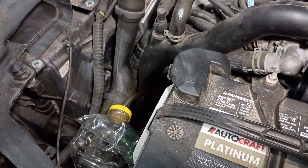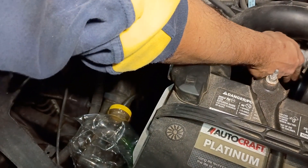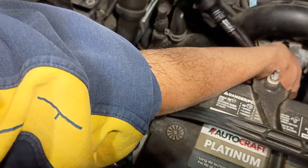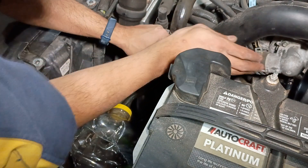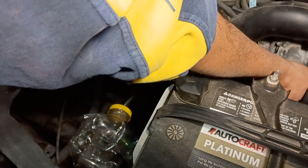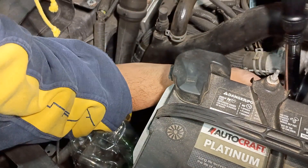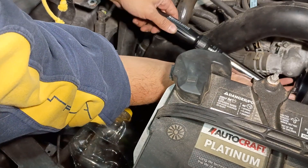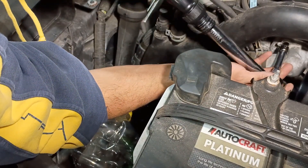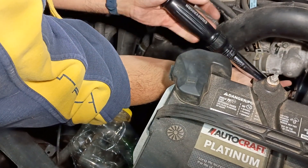There was still a little bit more mess. I was trying to capture as much of the fluid as I could so I could measure what came out and put a similar amount back in. You have to push against the housing as you're hand-starting the threads. I already got these bolts hand-started and then I'm just going to tighten them a little bit until they start to feel snug, going back and forth. These go to eight foot-pounds, or on this torque wrench that would be 96 inch-pounds. I'm only doing this to try to even out the pressure on that O-ring. Not a lot of torque.